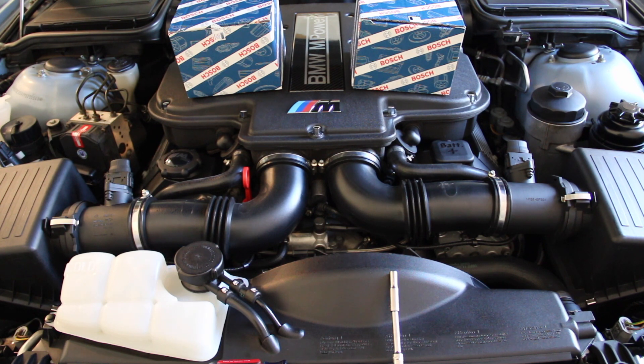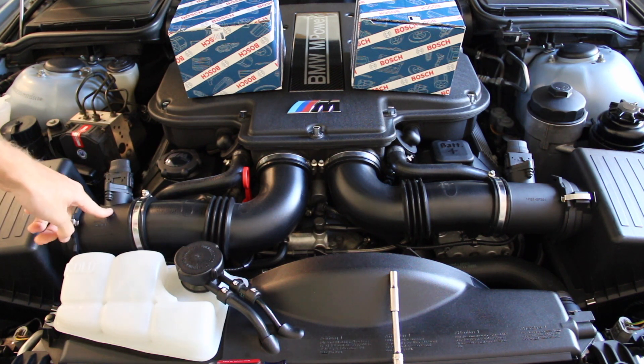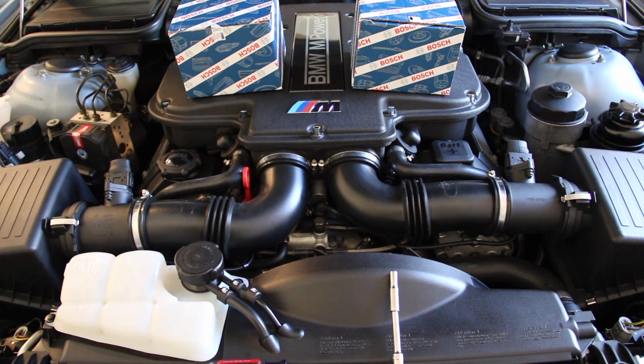It'll run too rich, it'll run too lean, it won't want to idle — it just won't run right. The issue I've been troubleshooting is extremely poor idle, but sporadic for some reason. I switched the mass air meters out to these, which are actually from 2003 with 151,000 miles, and they are performing better than my other ones with a fifth of those miles and only three years old. Something got fouled with those old sensors, so I put these in and now I have new ones.